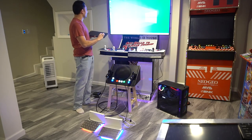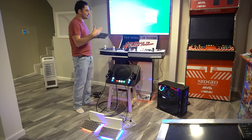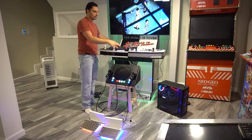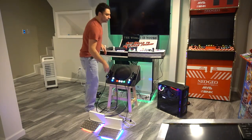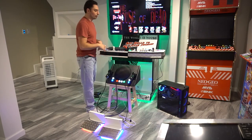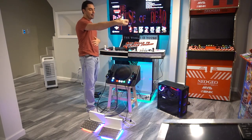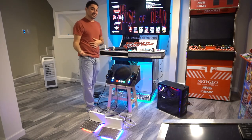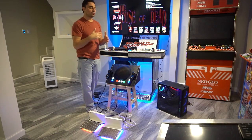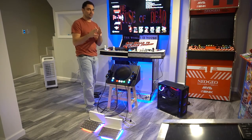Basically, even in Big Box, let's just pretend that Big Box launches. As far as the USB connections, you're going to put the connections in the rear. I'll put a picture up real quick. Don't use the top front PC case. It's just better to do it directly to the motherboard to avoid any interference or a disconnect.